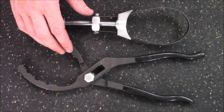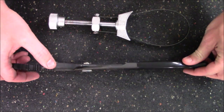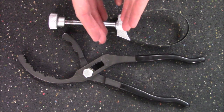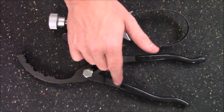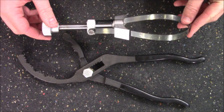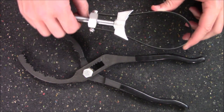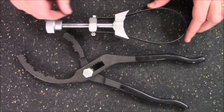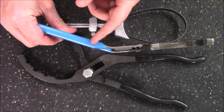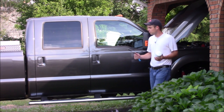Here are a couple of other styles of tools I use to remove oil filters. One of those is another pair of oil filter pliers, but the head has no offset — when there's an obstruction in the way the handles will end up hitting it, preventing it from being used. The same problem comes up with the strap wrench: it has to clamp down around the filter and then you use the end to turn it, but if something's in the way it won't work either. That's where the Channel Lock's offset head can clamp on and remove it because the handles are completely offset from the head.